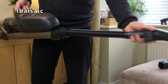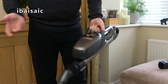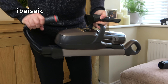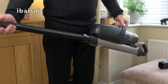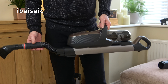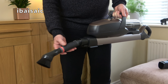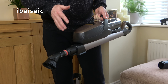There's another little trick: the machine has a built-in hose which is much easier to use. With the cleaner in one hand, you can pull out the hose and use the crevice tool for your nooks and crannies, or pop the nozzle on the other way for the dusting tool, or open out the wings for an upholstery nozzle. The built-in hose is permanently on board — a very good idea. You can't fit a motorized tool to the end of the hose; to fit a motorized tool the hose must be retracted. There is a smaller motorized tool available in the additional tool kit, which increases the machine's versatility.